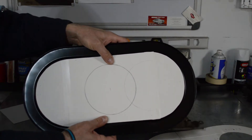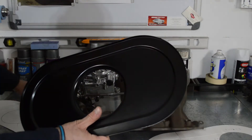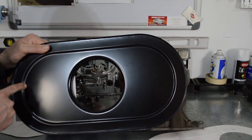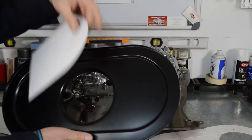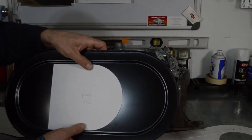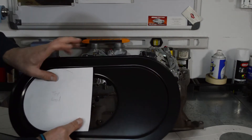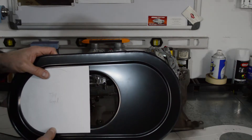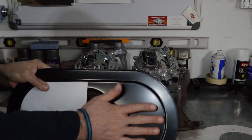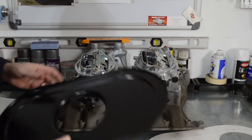Here's my thinking on the base: that inside lip is where I don't want to cut on the outside and have to deal with welding that lip - that's where the center carb opening is. What I'm going to do is cut maybe a quarter or half an inch away from this lip, cut the whole thing out all the way around, then cut a piece that big for both of them. If I cut two of those and flip them around, I believe they will both fit in there, weld them back in place, and that should make my dual carb base.